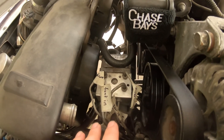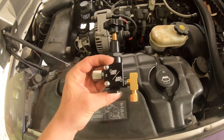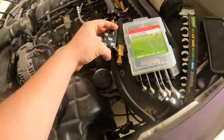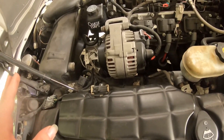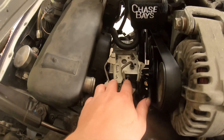When we remove this valve, we're going to be putting in this Chase Bays brake bias valve for the rear brakes, and for the front brakes I just have a basic T. I'll show you all the part numbers and the adapters I'm going to be using.